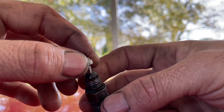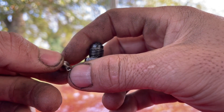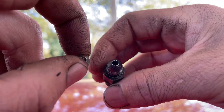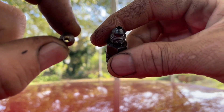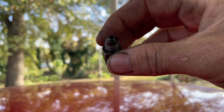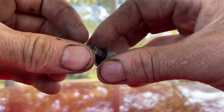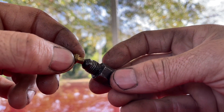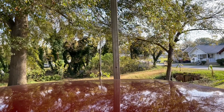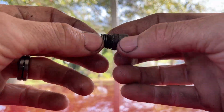This small nitrous jet — this is a small shank. If you look at the end of it, this is a 68, so I can restrict it down. See the hole that size there? I can restrict it down. I got different size nitrous jets. This is a fat shank, it won't fit up in there without drilling it because it's fatter. But if you get these little small ones like this, it'll slide right on it.